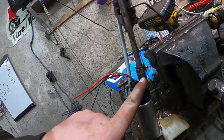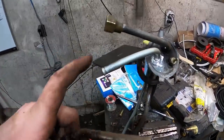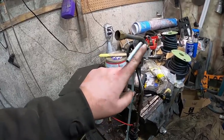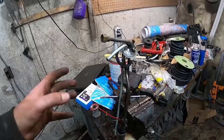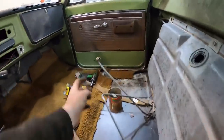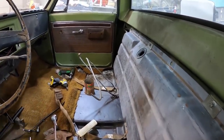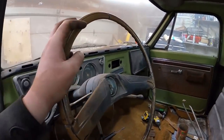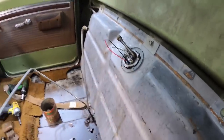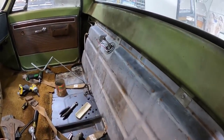The sock is cut and the pump is on with its little sock - it came with two little clamps and a piece of hose. I put a piece of mechanics wire on it; it seems pretty sturdy. For the return tube I just flared the end and soldered it in - I'll call that good enough. I need to extend the wires and run them through somehow. This will hook up to the existing fuel system which goes straight down. I've got the two grommets - I'll run it over on the driver's side since the fuel rail is on the driver's side. The sender is in, wires came through, and I put some seal-all on it.